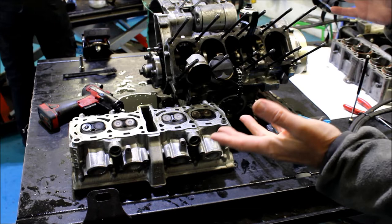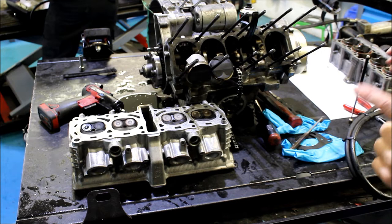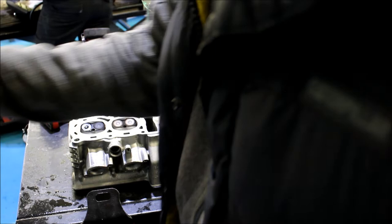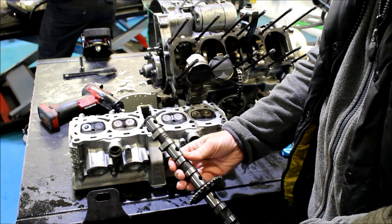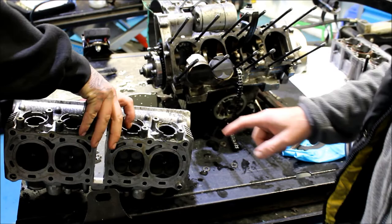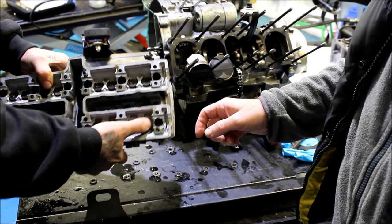It's very sad looking because it's come in for some new pistons and a rebuild. It's been absolutely rebuilt once or twice before, yeah. But it turns out it needs a bit more than that, because I'm told it had a camshaft that broke in half - the end did break in half and it caused damage. There you go - that looks like a very sad-looking camshaft. You can see it's shattered. And when that broke it didn't do the engine much good - there's a nice hole in the front of there.